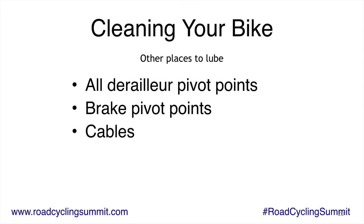And your cables. So where your cable goes into the housing is a place where you want to put a little lube possibly. And then where it goes under the bottom of the frame, depending on your configuration on your bike, you'd want to put a little bit of lube there. That's a really big collector of sweat and buildup from energy drinks. It spills out of the bottles, goes down to the bottom bracket underneath there where the cable goes through that little guide, and it gets gunked up, and that can actually mess up your shifting. So you want to make sure when you're washing the bike that you clean that, and then put just a teeny bit of lube there to keep them going smooth through there. And that's pretty much it for lubing your bike.